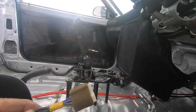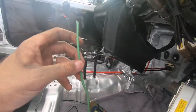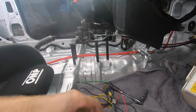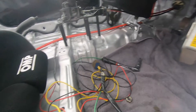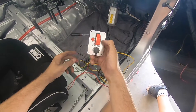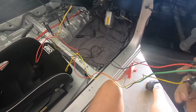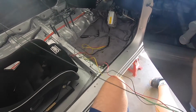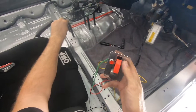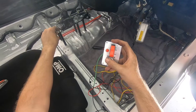I haven't connected up our ground wire — I did it in green because I've already got black, red and yellow on this wiring and green for ground made sense to me. We'll wire it up, plug it in, and see if she'll fire up. We have our ignition switch plugged into our harness over there — it's a bit of a mess of wires. Our ground wire — just to ground it out somewhere at the moment — we'll just ground it out to one of the bolts on the shifter just to hold it there and make sure it fires up. Crossing our fingers, don't have to chase my tail for some electronic work. Well that's a good sign — got a red light meaning ignition on.